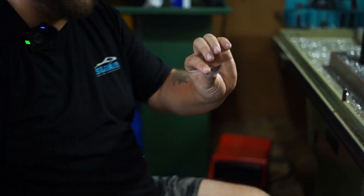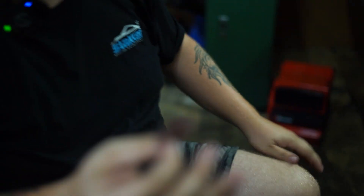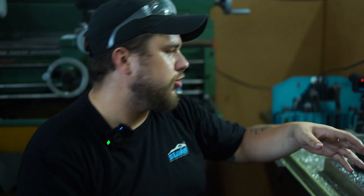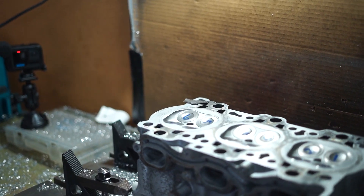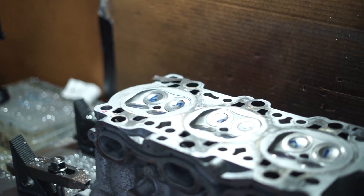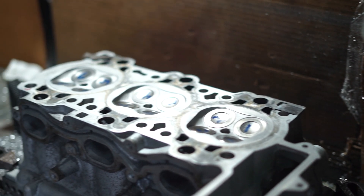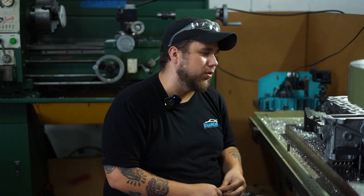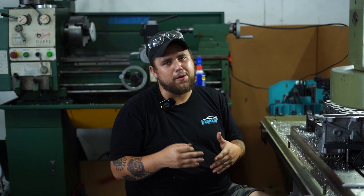These are just some stainless steel shim material. This one in particular is a thou, and I've got one, two, three, and five thou shims — it allows us to really dial in the level. The reason we want it level is to make sure we're taking the least amount of material off the deck. The thickness of the head is really the life of it, or how many times we can rework it before we'd need a new head — or do something special like double gaskets, or figure out piston-to-valve clearance.